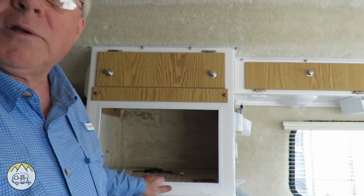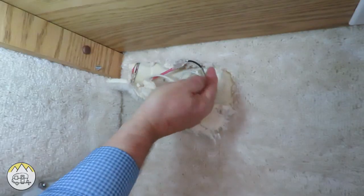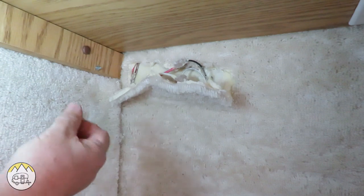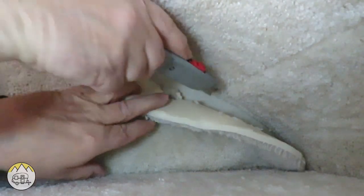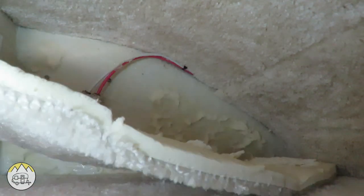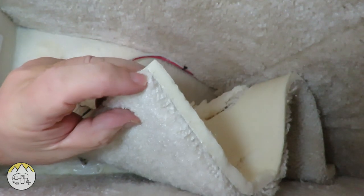I'm going to pull the fuse so there's no power going to this wire so I can cut into it. The two cabinet doors are kind of in my way for this project, so I took the bottom one off by removing the four little screws from the hinge, and I'm taking the top one off now. I'm going to be cutting into this black wire, splicing on another black wire, and running it up through this carpet into the top cabinet. For those of you wondering how well Casitas are insulated — the Casitas are lined with carpet, and this foam rubber is glued to it, and that is the insulation in the trailer.